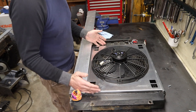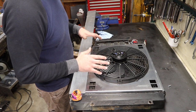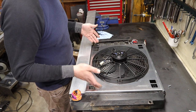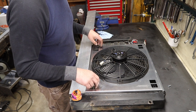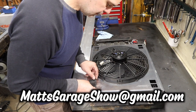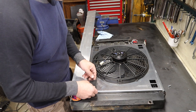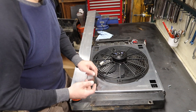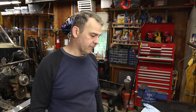It's going to be plenty stiff. What that does is now the fan is going to suck the whole surface area worth of air through the radiator — this is a great setup. I'm super excited. This shroud also has these holes with silicone flaps that push in. When you're sucking air, the holes are closed, but when you're driving down the road, they flap up and let air through, so you get less drag, which is very important on the Scout. The shroud is like 70 bucks, and I think I paid 10 bucks for the aluminum, so this is definitely one of the most economical shroud solutions.